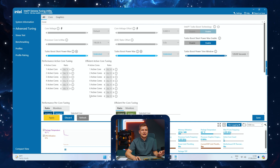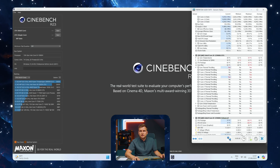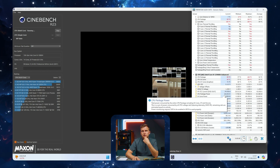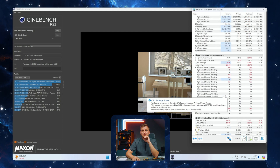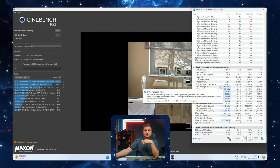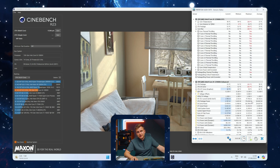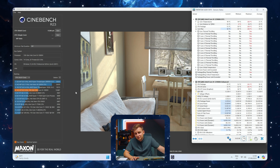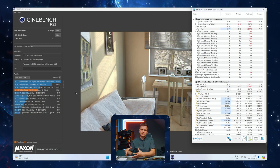I'm going to run everything unlimited and see how much power it actually pulls. Are you ready for some serious thermal throttling? Multi-core — go. Instantly: 100 watts attempted, 74 watts actually pushed through. That's going down fast — 66, then 62. Only 3.3 GHz on the P-cores now. The fans have kicked in quite loud, trying to cool this down and maintain high power draw and boost clocks. We cooked the CPU: 74 watts, 101 degrees, everything thermal throttling. Score is 15,283 — about the same. I recommend sticking to the lower limits because the cooling simply can't handle more.